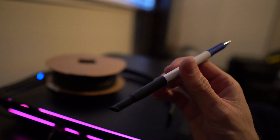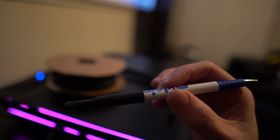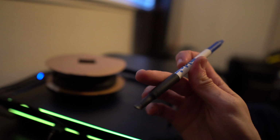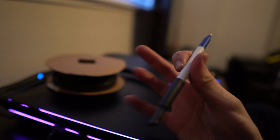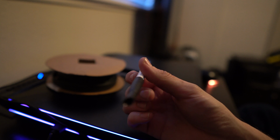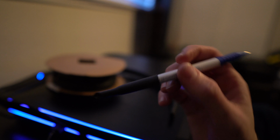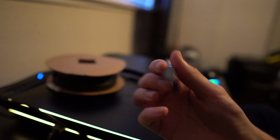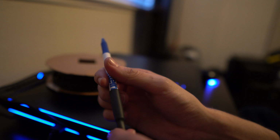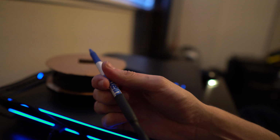This is the 3/8 version of the DR25 RAYCHEM, and that's how much it shrank down. So it went over a pen, and it had quite a bit more room. So I'd say that's about 4 wires of 14 gauge AWG wire, which is what you'd want to use when you're doing this, and that's what I actually purchased, but it has a gnarly hold on it.